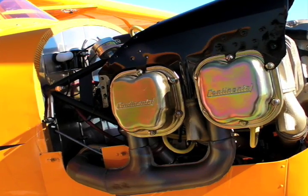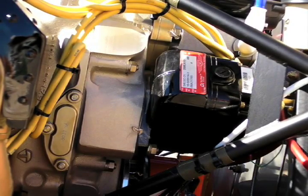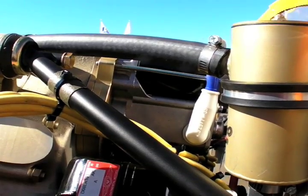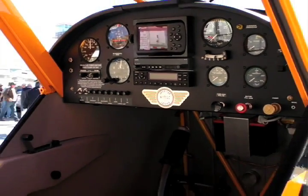Of course, it's derived from the old C-series engines, which a lot of pilots think is as old as dirt, and that's kind of selling it short. Continental spent a fair amount of effort developing this engine. The primary goals were to take some weight out of it and also to improve the accessories — the starter and the alternator in particular. Changes on the LSA version include a lightweight starter by Skytech, a lightweight permanent magnet alternator, and a variety of internal changes meant to reduce weight without doing anything negative to durability. The only knock is it's a bit on the heavy side — around 200 pounds — so you have to have an airplane that can handle that kind of load.